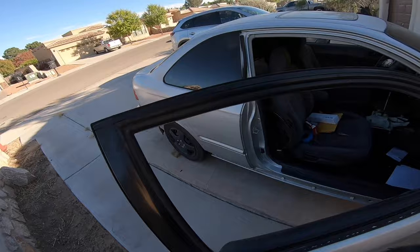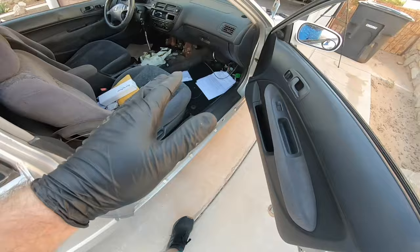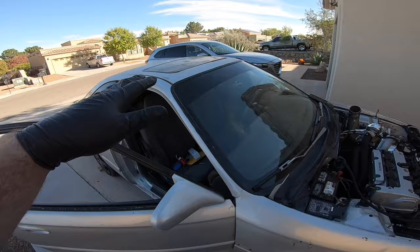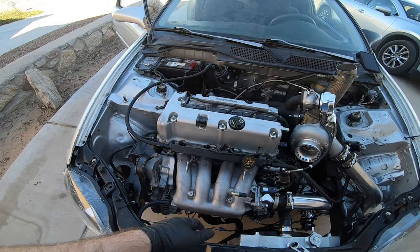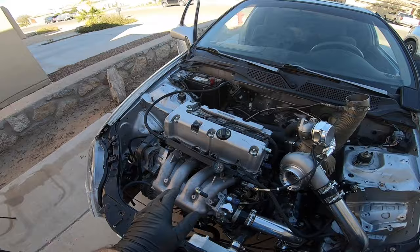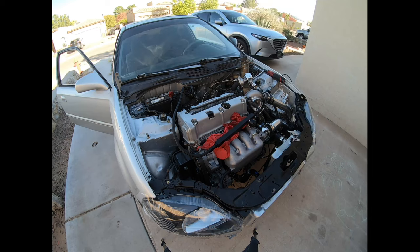I was going to bring the O2 sensor wire through this black hole here, but the EG doesn't have any of the air conditioning or blower stuff, so this wire is just run up where all the other wires are. I think that takes care of all the easy stuff. Going from easy to hardest, the fuel pump is probably the hardest since most stuff has to come off. The rail isn't hard but it makes a mess. We're going to take the rail off, pull the injectors, put the new ones in with adapters, then work on the pump.